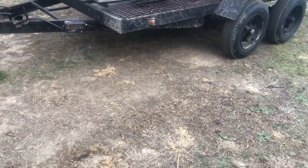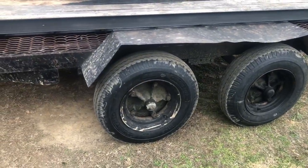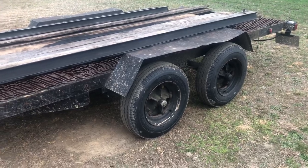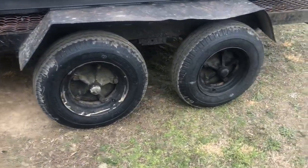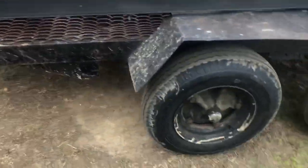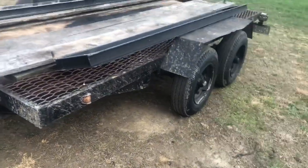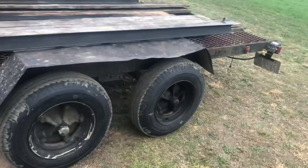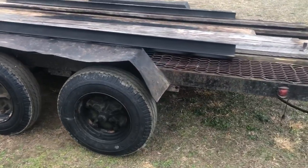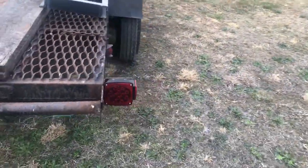I've looked at a few places like Easy Trailer, Redneck Trailer Parts, and NAPA. I brought the guys at NAPA a picture of what the brakes look like because I took the whole hub apart just to see what I needed. Honestly the shoes and hardware don't look bad, but the magnet just swings in the breeze and when you move it back and forth it doesn't push out the brakes at all. So I haven't bothered to wire them up — the trucks still stop fine and I've hauled a Jeep Grand Cherokee and a Cavalier on this trailer without trouble.